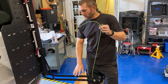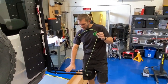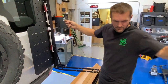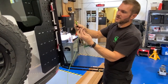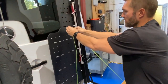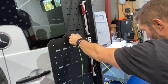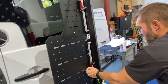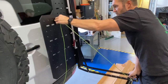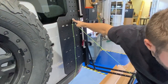When you're setting the cable with your one-up, typically you'd have both one-ups mounted, but you want to get this kind of 90 degrees to the ground. Then once you have both cables, you want to put one of these button head bolts with a big washer through both of them. Find a hole that's kind of centered. So if that cable is stretched out a little bit, put that on and then put a nut on the back side of it.